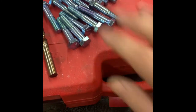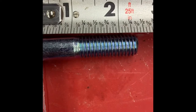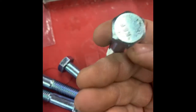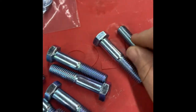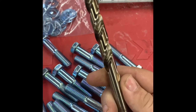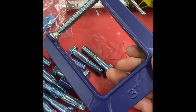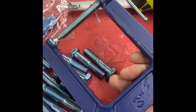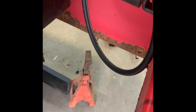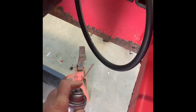For this project you're going to need 15 half-inch by roughly two and a half inch — two and three-eighths somewhere in there — high-grade bolts, 15 washers, 15 nuts, a half-inch drill bit, and three clamps. Also, before you mount your cutting edge, give that area a good shot of fluid film as a rust inhibitor, because you won't be able to get in there as well once the cutting edge is on.